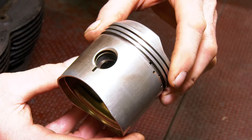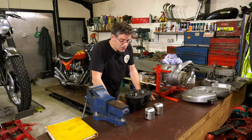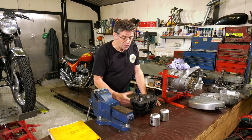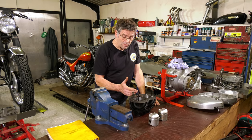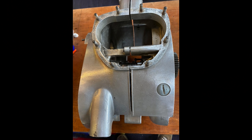So that's the right-hand side - left-hand piston, very good. We are making sure everything that is necessary is done. But just to say, you don't always think the bores need a rebore. You could end up opening that bore up to another 20 thou, going out to 40 thou - new set of pistons. So you're paying out for new pistons complete with rings and a rebore, which makes it really quite expensive. All I've done is honed it out with a new set of rings - there's a big difference in how much I'm spending. And I'm not wearing those bores out by oversizing when I don't need to.